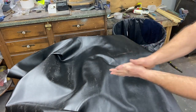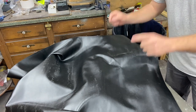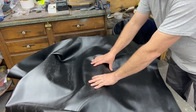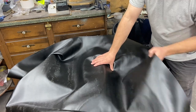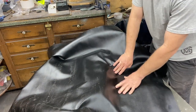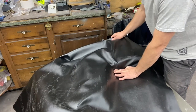I'm not going to go too super into detail on this because you can always go back to my dash video or the center console video where I really show how this black vinyl gets glued down. But doing these rear pieces, I learned a critical lesson from the other side. You want to make sure that you have plenty of material all the way around, because once you start sucking this down in and it pulls tight over here, you don't want to end up coming up short after you've got it all glued down.